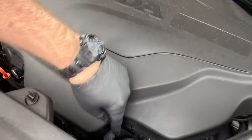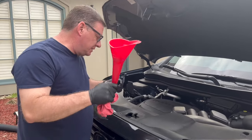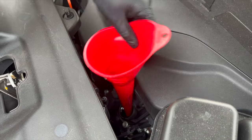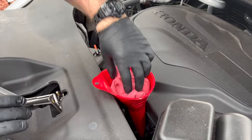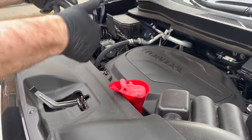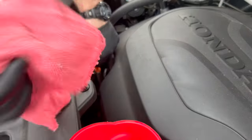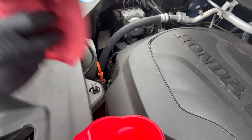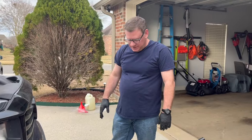This is where we're going to add the oil, right here. While it's on the ground I'm going to break that free. I'll put this funnel in there — it goes right in here — and then just to keep debris from getting in there while I'm working, I'm going to leave that rag in there. This orange one is our oil dipstick. I'm going to break that free as well, just so there's a little bit of airflow so the oil drains a little faster.